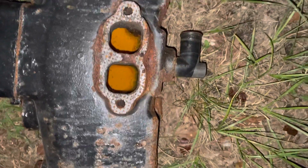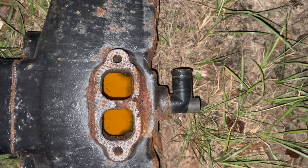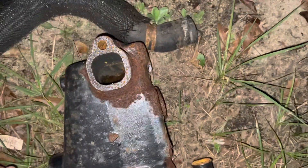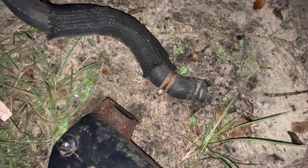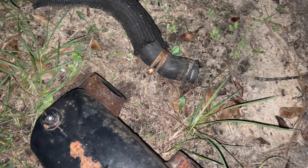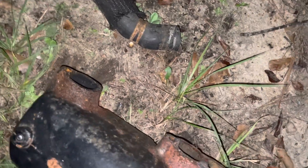That's something you've got to watch out for. The plugs I'm using are AC Delco MR43LTS, which is what the manual calls for. I've read that you can buy a shorter spark plug that will fit in there. You've got a little bit of space between the manifold and the cylinder head, so I'm going to do the research and see if I can find a shorter spark plug to fit with these Sierra manifolds.